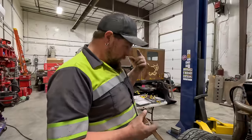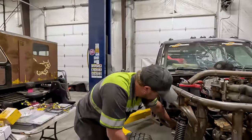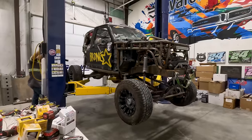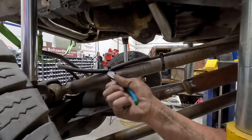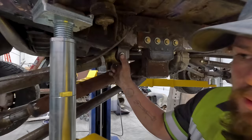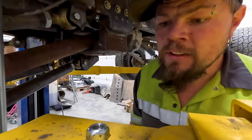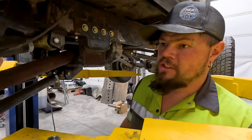I'm going to lift it up and start cutting. I'll bolt the upper mount — or the upper link — off the frame, and start getting the mount for the upper link cut off the frame so we can relocate it to where it needs to go. In order to pull these upper links, I'm going to cut the zip ties to get the lines off, find the right size socket, get the bolt out, and then work on the other side.